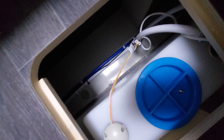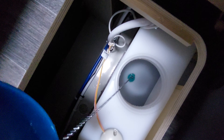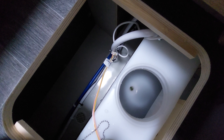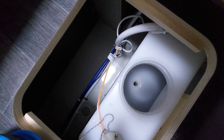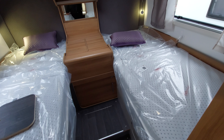Going back to the safety of the tanks in freezing conditions: this is your fresh water tank. There's a lid which leads to a bung in the bottom — pull that out to drain the fresh water tank. In freezing conditions, if you leave water in there and it freezes it'll expand and can crack the tank. Whenever the motorhome isn't in use, especially in cold conditions, use this system to drain all the water out. There are three things to drain: this fresh water tank, the waste tank shown on the outside, and the boiler — that yellow drain in the garage — which also needs draining down.